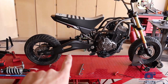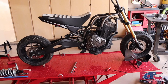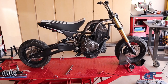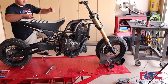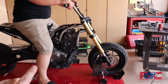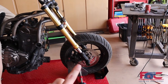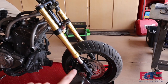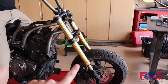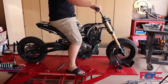Normally the wheel would be sitting a little more underneath the tail here, but I think this is exactly what we were looking for. So now I'm going to have Paul jump on the bike so you guys can see what the suspension is looking like. We still need to get some stiffer springs in the front — we're adding weight to the bike, and whenever we come down from a wheelie or hit bumps in the road, we're sitting pretty close to bottoming out these forks. So we have to get some stiffer springs in those for sure — we already knew that going in.